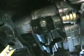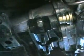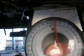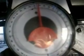and 2 inches. Actually, before I do this, I need to level this motor and stuff, put it 3 degrees to the frame, 2 degrees, 3 degrees, and then I can start actually measuring more specifically what I need. Did some checking, and it looks like the frame is between 0 and 1 degree down here. Just off a bolt in the transmission pan, I'm like 8 degrees, so I'm going to try to let this motor down and see if I can get a little better.